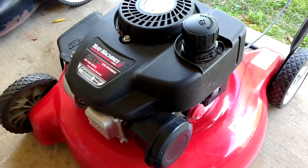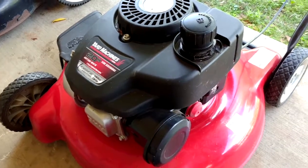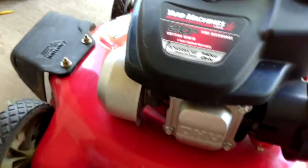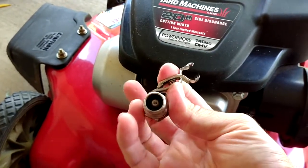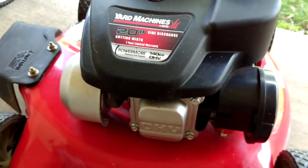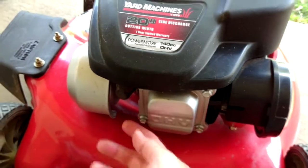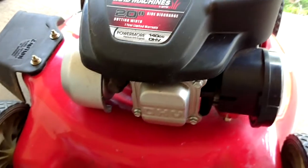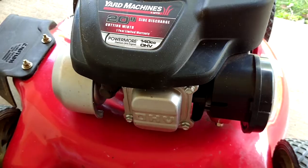His is not running, so I'm going to do a few things here to see what's going on and see if we can get it fixed back up. With most of these small engines, when you don't know what's going on, the very first thing I do — after checking to make sure it's got gas, which it does — is pull off the spark plug wire and check for spark with this little spark plug checker. Once you've identified there is spark when you pull the rope, then you can concentrate on the fuel system. That's my advice: before you start buying spark plugs, before you tear apart the carburetor, before you throw this thing away — check for spark first. If it's got that and it's got compression, fixing the fuel system is fairly simple.